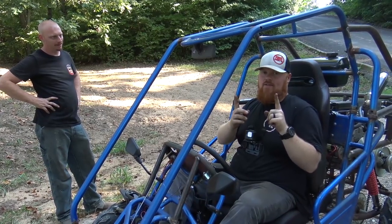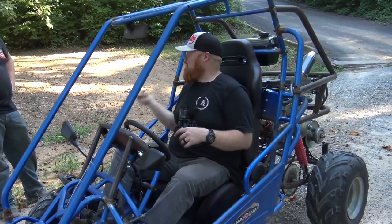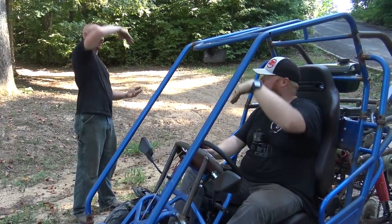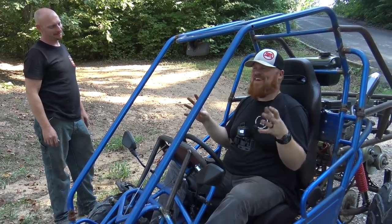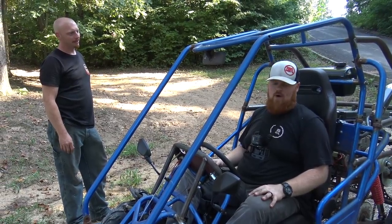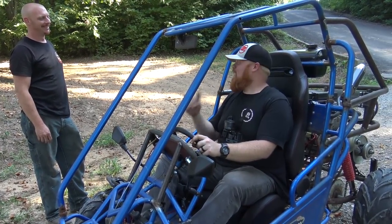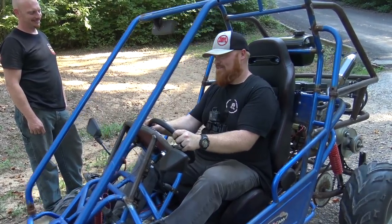The axle is the biggest weak point, so we bent this axle already, maybe from a jump in the driveway. It might be a jump in the driveway, but I think it's when it hits the high end and comes back down, the end slam. So now we just need to basically pull the axle off and build those ears that sit right behind the tires. I think what's happened is it's just warped. Watch this back tire. I see it. I'm going to turn around and come down the driveway. You can see it coming down the hill.